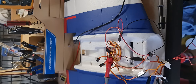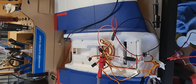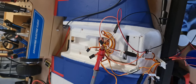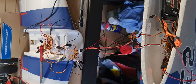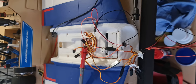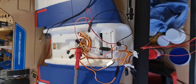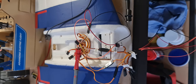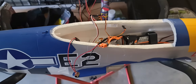What I was hoping was that maybe it was the signal cable — zero voltage on the signal while operating would tell me it was the signal cable, or if there was signal and it wasn't working it was the power. But it seems fine. My solution is to re-splice, re-cable, and rewire it. If it still does it after that, that tells me it's maybe the actual retract motor. After doing all that and it still does it, I'll diagnose it again. That's my simple little setup for diagnosing things.